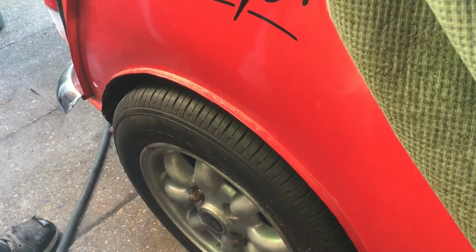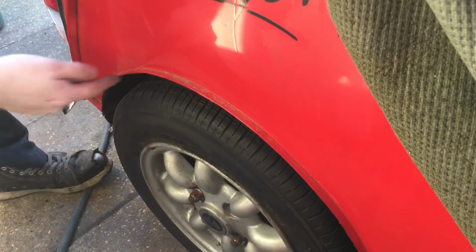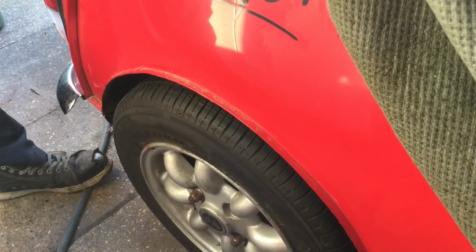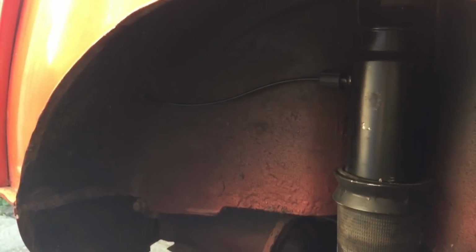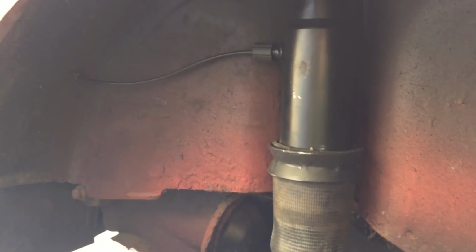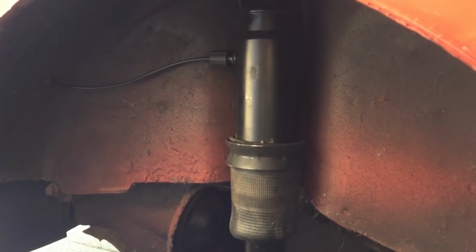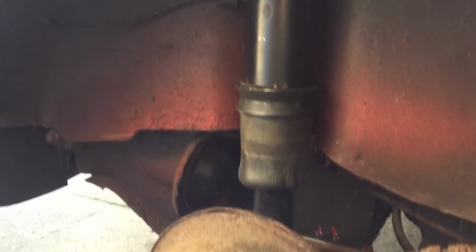Hey, yeah, we done good. So I just need to take this wheel off now, because I'll show you. I fed the pipe through the rear wheel arch on the other side, so let's just whip that off before it's too dark. Okay, the sun's getting quite low, so sorry about the glare. So this is the final setup. Going along there, I've drilled a hole, a little grommet for the pipe to go in through the back of the wheel arch, and that goes off to the solenoids.